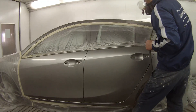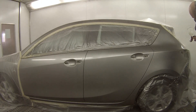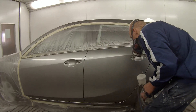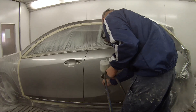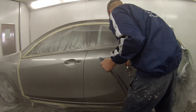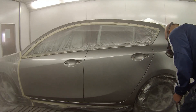Not going on too wet with this because it is a Mazda — they've got a very fine peel on them. It's not like the European cars that have a very thick orange peel. So I'm going a bit quicker than I would if I was painting a European car. Pressure for the clear coat here I've got around 2 bar, maybe a touch lower, which is about 28-29 psi.